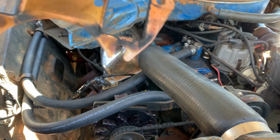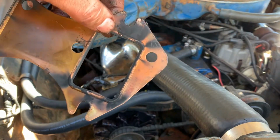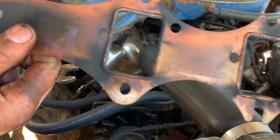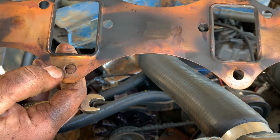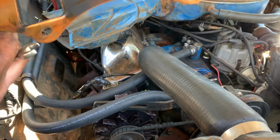Gasket in there. So dented here, dented there, nothing on this one. Very light here, maybe light there, and up on top on this one. So apparently not the right gaskets for these kind of headers.